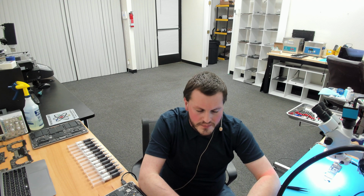For a while now, Apple has been using a very special type of thermal paste on many of the devices they manufacture. If you've ever taken apart an A1932 MacBook Air or maybe even an M1 MacBook Air or MacBook Pro, you would have seen this thermal paste. It is this very, very thick, gritty, black thermal compound that you just can't find on the market no matter where you look. Now, they use this paste for a few reasons, and one of the reasons is that the heat sinks on the devices that this is used on are simply too big for standard viscosity thermal compounds.